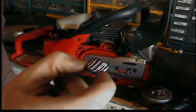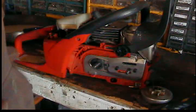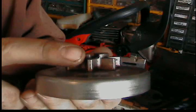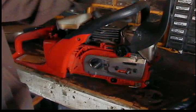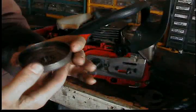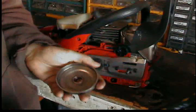After you get those off, you can take your clutch bearing out. Every time you take that off, I'd probably replace it. If you look on this sprocket here, you can see two little notches, one on each side. Make sure when you're putting it back on — there's a little notch there and a little notch down here — those drive your chain and bar oil, so make sure those notches line up or else you won't be getting any bar oil.